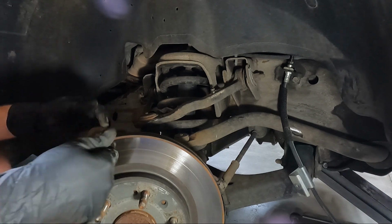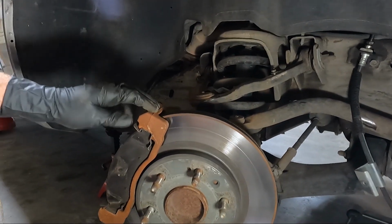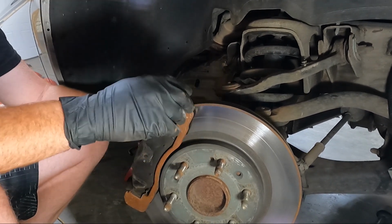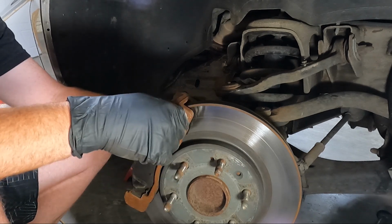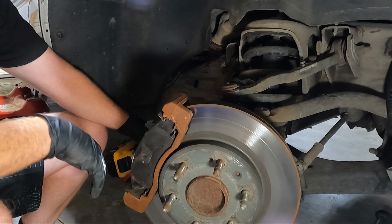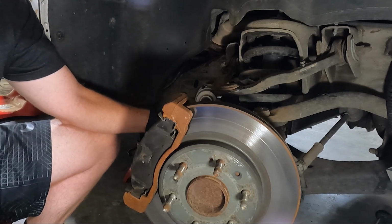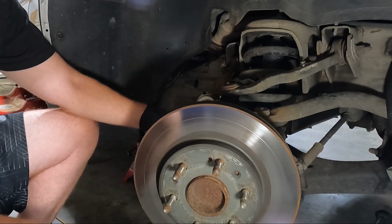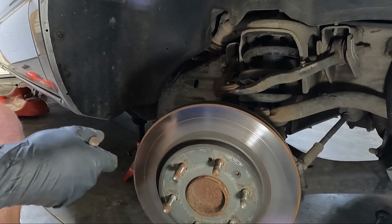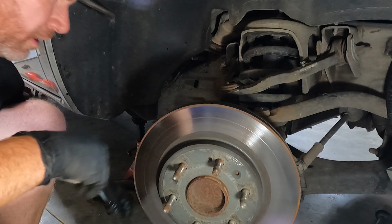Once we do that, we need to get the 18s out that hold the actual bracket on, which is this guy right here. And you can leave the pads in it. Remember, we're gonna be replacing the pads, so I guess actually I'll have to take the pads out, but you need to grab an 18 and get this guy off. I will tell you guys, having an impact makes your life so much better. Get one. I always list it in the description down below because it's literally one of the best tools I've ever purchased. So that came off, not quite like how I wanted it, but we'll set that aside.